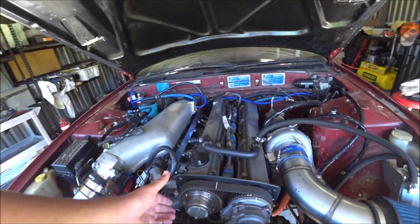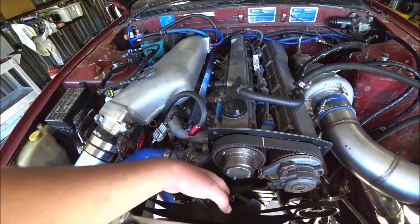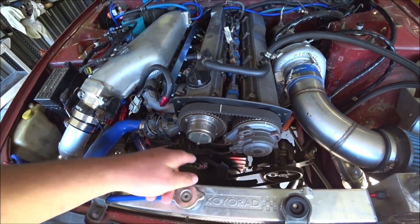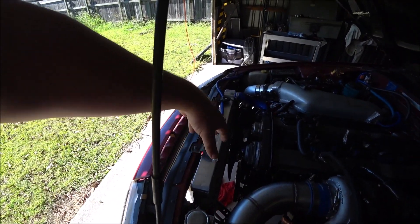The other issue — because I've had this cover off, I noticed when it was running that this belt tension's probably not high enough. So I'm actually going to have to pull all this stuff off again and re-tension that, reset it a little bit tighter. I don't want that thing skipping a tooth, especially after all I've been through with it. It's going to be a bit of a mission because I'm not going to be pulling the radiator out this time — I'll have to do it all with that in there in the way, which is entirely possible, just not the easiest way to do it.